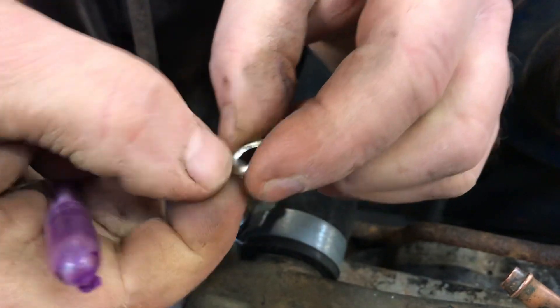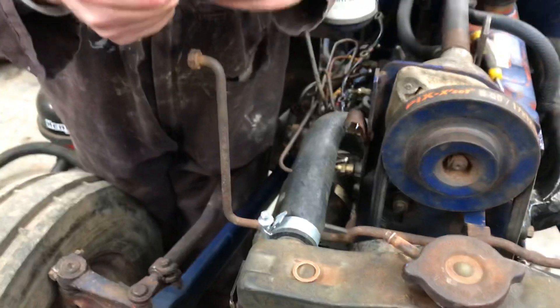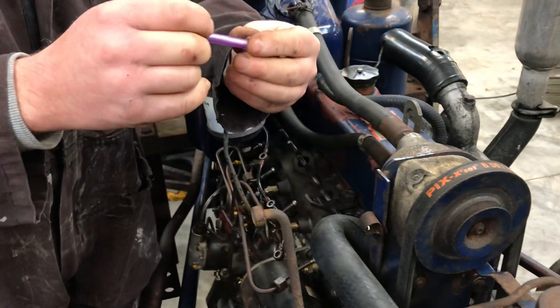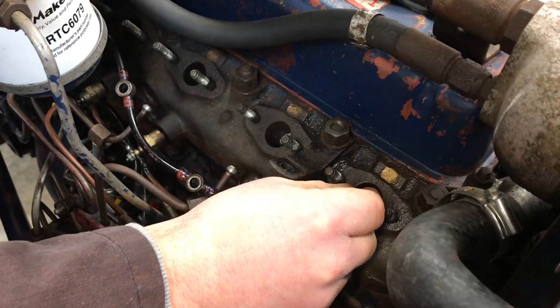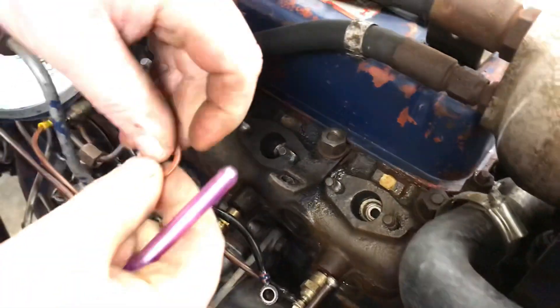This face with the one hump needs to be in contact with the tip of the nozzle. The way I fit them is by getting a pen — with the hump facing out towards me — and putting the pen down the hole like that, so it falls in the right way. You then pop your injector washer in.